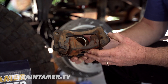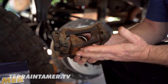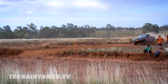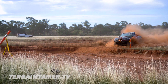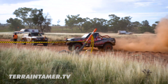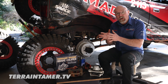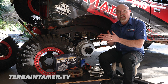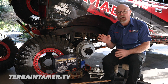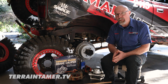There are other areas on a caliper that do wear as well. These areas where the pads sit and are located can wear over time. In this vehicle, having performed thousands upon thousands of brake applications, those areas are slightly worn. Where that can give you grief is pad alignment — the pads can walk a little bit and drift during brake pedal operation. You can also have a situation where one pad does more work than the other, which is detrimental to your braking operation.